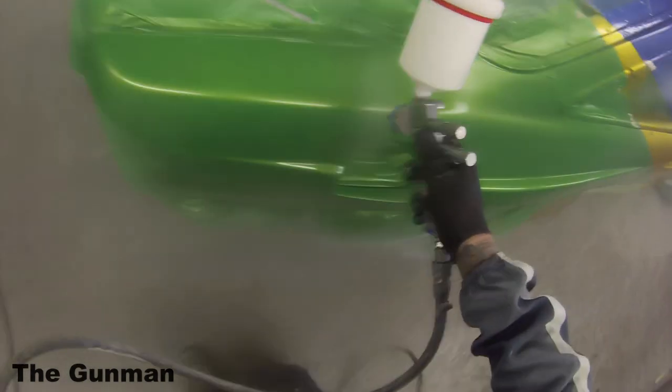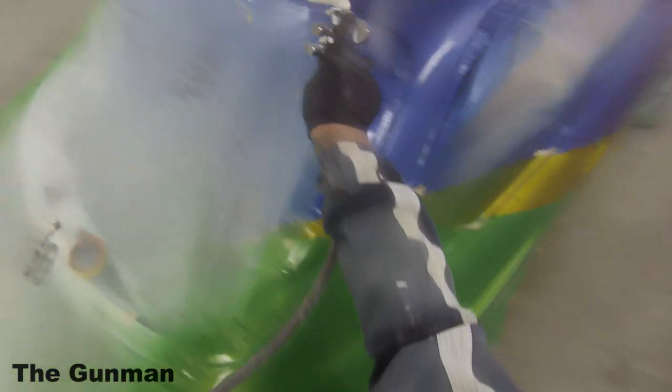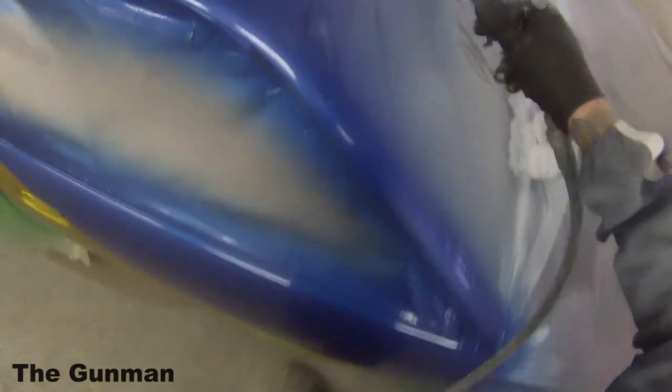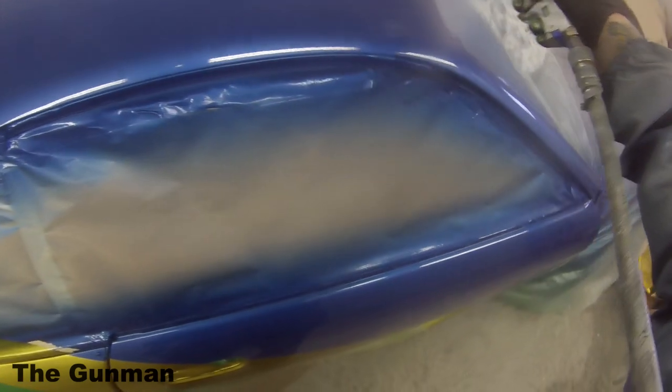Next question I'm going to be answering is by Adam Kuhn, and the question was whether or not it's okay to do a spot repair blend type of a thing with 2K paint, so direct gloss 2-pack. And my answer to that is not recommended, unless you're going to do it in clear over base. You can do solid, say for instance a solid white blend, but as long as you put clear coat over the edge where you're going to be polishing, well then there's less chance of that showing back.